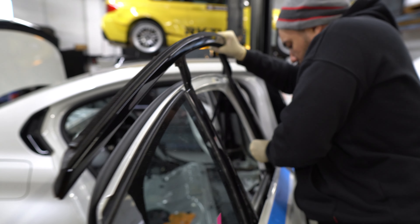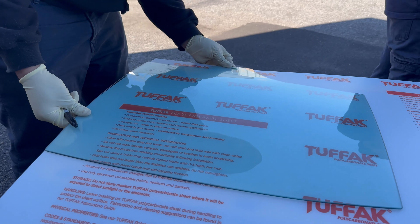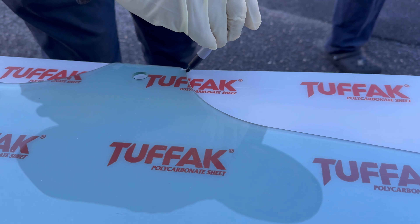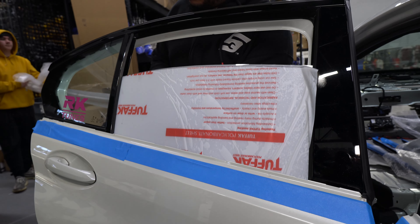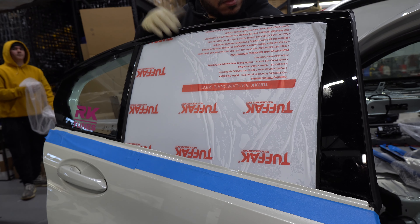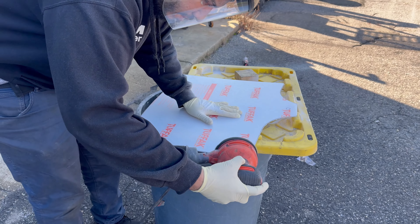To make the plexiglass windows it was a long process. All the doors had to be fully stripped down, window motors removed, and then all the glass taken out. The glass was then outlined on top of the plexiglass, all edges were cut and trimmed so they wouldn't damage my OEM door seals — that way if I ever put the OEM windows back in they would still work. The plexiglass was actually cut to work with the stock window regulator, but we're making custom brackets to fully lock them up so they're super tight and never move around. We had to do this four times.